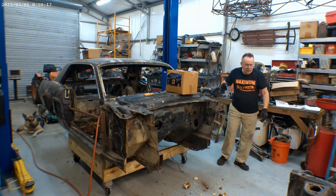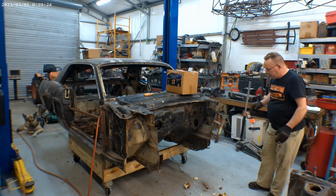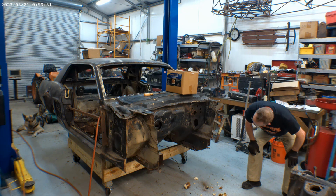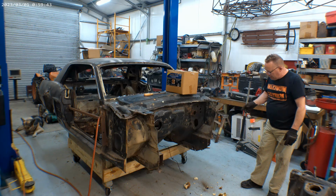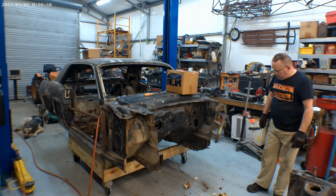Okay. So that is just a plate to keep it from crushing when bolting the steering box on. That plate can be taken out. Doesn't look like it's going to be too hard. I can drill a couple of holes, put the sawzall in, do a nice little square cut, use a carbide tip Dremel and grind it smooth enough to get the arms in for the rotisserie. That should work.